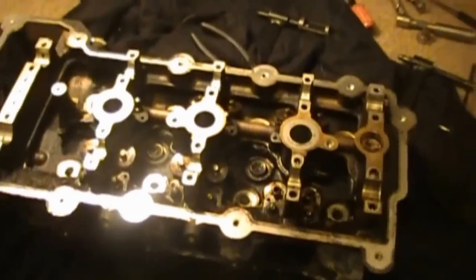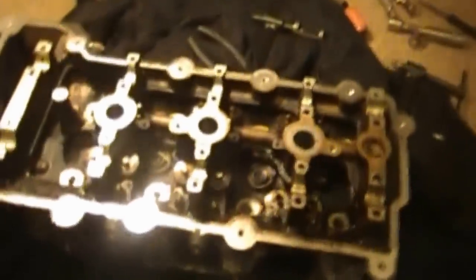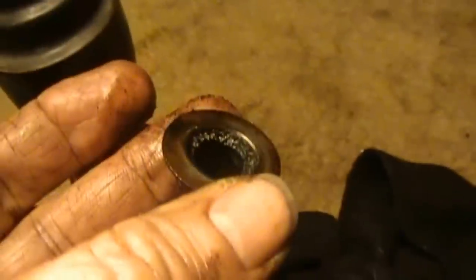Quick update: I'm putting my new valve stem seals into the head. Here they are, brand new, looking pretty good. These are the new ones that came with my kit. Here are the old ones I took out - these things are done, they're shot. This rubber part that actually keeps the oil from running down on the valve is so hard I can't even push on it. These things are shot - that was my smoking problem. I did take out the bad valve and check it out - completely shot. I've ordered two new valves from Napa at $17 each.